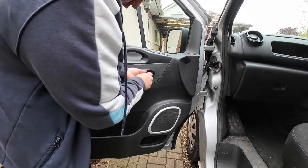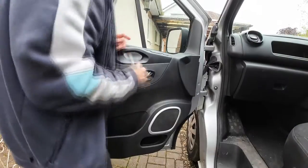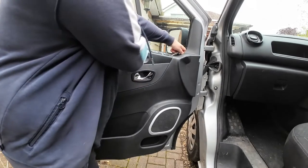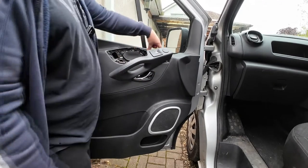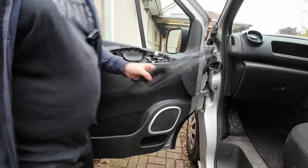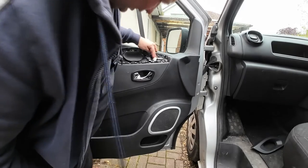So that's that one out — don't lose your screws, I've put them in the dashboard. You could do with a trim kit here really, but I can't find mine. I'm just coming in from the top and prizing it from the top there, and there we go — that just pulls off like that. Then we just pull it along and you have got an electrical cable in there, so you just pop your block off and take that off. Just put your screwdriver in that little gap and push it, and that will spring off.